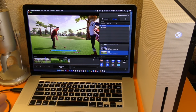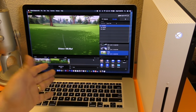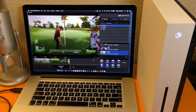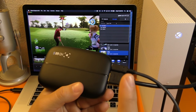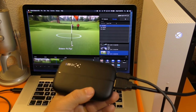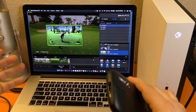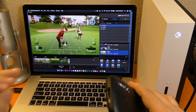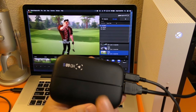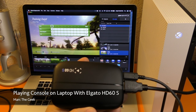Just wanted to share this video with you guys. It is compatible with every console on the market. Remember, to have the instant game view — which allows you to play on the computer — your computer needs to have a USB 3.0 port, but if you have only one, that's good enough. All you need is the HDMI from your console to the Elgato, and the USB cable to the computer. You don't even need to connect an HDMI to your computer — just a USB 3.0 port and that's it. Thanks for watching — I'll leave a link in the description. Till next time.